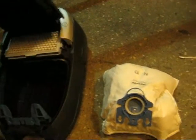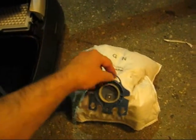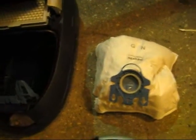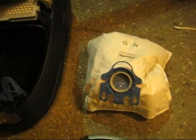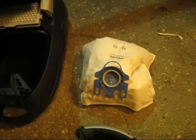But you always want to take it outside. Even these bags — all vacuums — you want to take it outside to change the bag. And all HEPA filters and air cleaners, always take them outside to change. Because despite carefully handling this bag, I guarantee there are going to be some particles coming from it, even if you can't see them. You don't want to put them back in your air. These are good bags for the Miele — they have a trap door that actually closes. Most bags don't have that; when you open them up you get a spew of dust back into your air. These are pretty good, but even so I still take it outside.